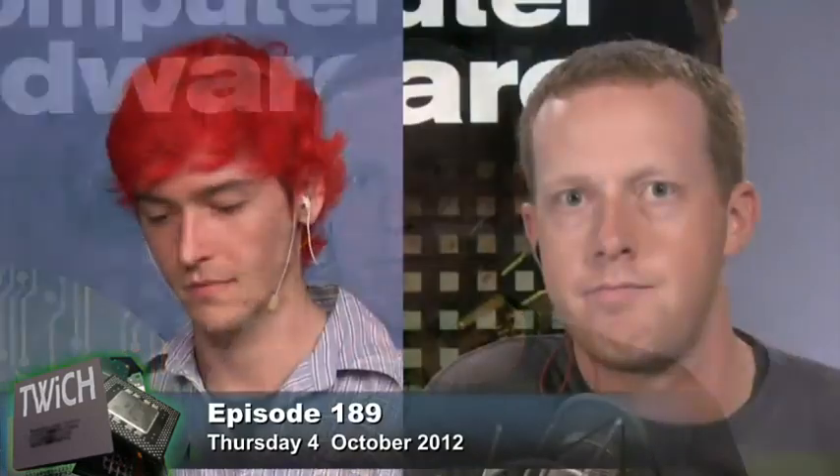The motherboard selection is necessary for the Hackintosh, and it's a fine board anyway. The processor — the top Ivy Bridge you can get, the only way to go faster is into X79 Sandy Bridge-E, but I probably wouldn't recommend that. 16 gigs of memory is a lot. The only thing I might look at is if you can get 2x8 instead of 4x4, just in case you want to add more later. If you're going to do video editing, you never really know where you're going to go with that — and if you can upgrade to 2x8s for close to the same price, I'd do that.